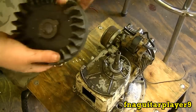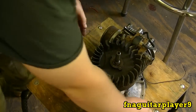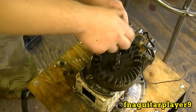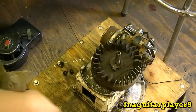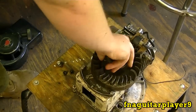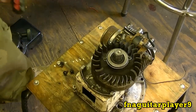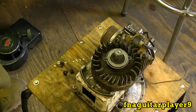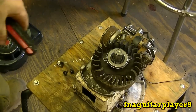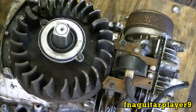We'll switch back to this engine to show you. Line up your keyway slot right there — some people will put the keyway in first, but it usually works better to do it like this. Take a screwdriver and pound that in flush. Put your starter clutch back on. You can use either method to tighten it back — pound it on like you took it off, or use the two flywheel tools. Make sure it's real tight because if the flywheel is loose, the engine will shear a flywheel key very easily.